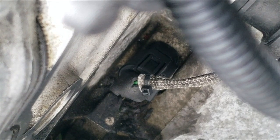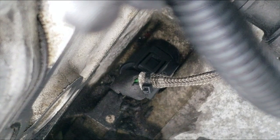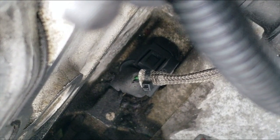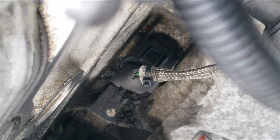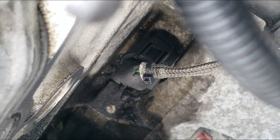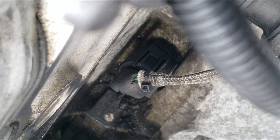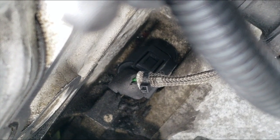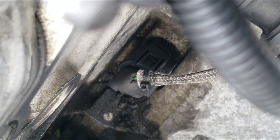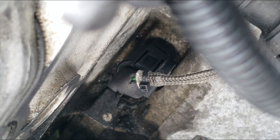That means you need to rotate the crankshaft position sensor a little to the left or right, depending on how it looks. You have to visually eyeball it. I can tell right now that it's right, and the bolt went right in. Sometimes it's a little stubborn. With my son's help, I was able to get it in the correct position and the bolt started to thread. It's important that you thread it by hand first before you attempt to stick the ratchet on it.